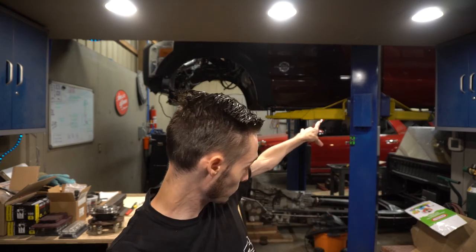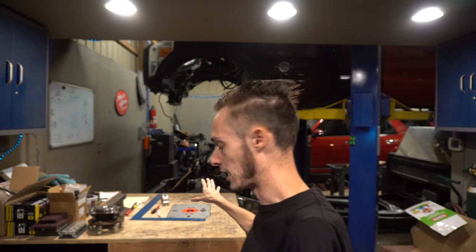We're going to cut those out of a big 4x8 piece of masonite we have in the corner of the garage, so we can make a big radius arm. We'll use our router table to shape it how we want it, because there's no cardboard that big, and I don't want to go down to the appliance center to get a big refrigerator box, and we have that masonite to use up. And it's 1/4 inch, so it'll be accurate, just like this other cardboard, to what size steel we're going to cut all these parts out of.